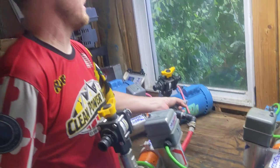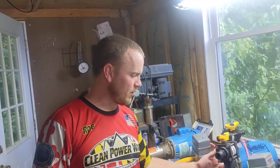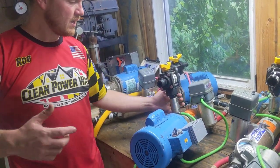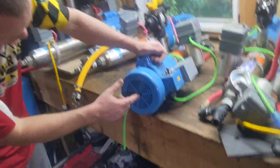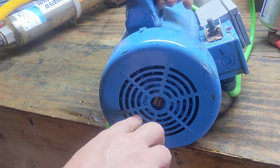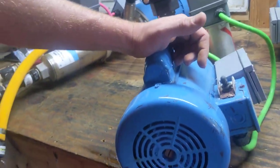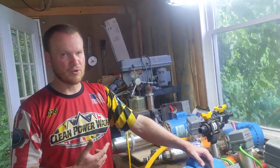Make sure that before any time you're servicing these, you force-feed water through the whole system so you don't end up with leftover roof mix that your employees forgot to tell you was still in there. Also, if it's going to be sitting a while while you're troubleshooting it, do that. These ones on the back have a way that you can spin the internals by taking a screw through there. If you hear a crunching sound, you may be able to get through that job, but your diffusers are toast.